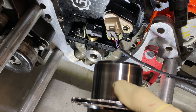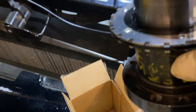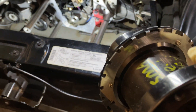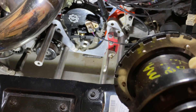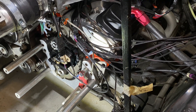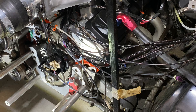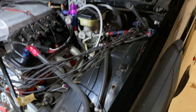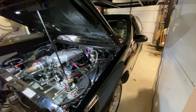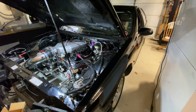He'll source the ATI hub and get it machined and put on. I had just received this back a couple of weeks ago — the reluctor's on there. I'm just going to press the hub back on today. Eventually one of these days I'll be done with this 383 with an F2 blower in a 96 Impala SS. Racing only — this is not a street car.